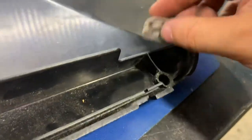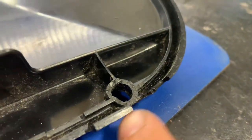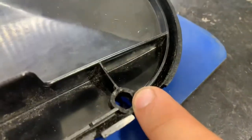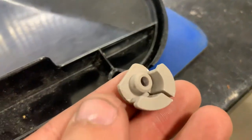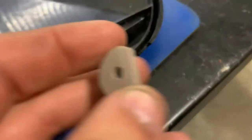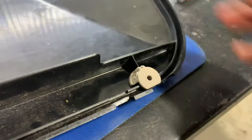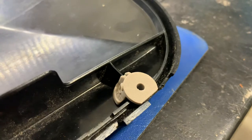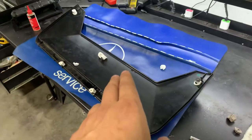Now if this breaks as far as it did here, we couldn't do the hooks like on the other one. So what we had to do is this piece will have to be drilled to this diameter, because we have a self-centering nub on the inside here that will also help spread the load. Once you epoxy this, it literally just snaps in just like that and you're done. Epoxy it down and you've got a perfectly quality repair after about 24 hours.